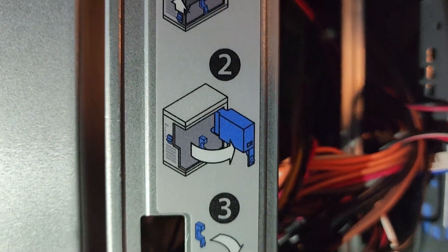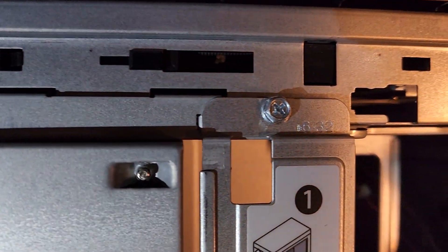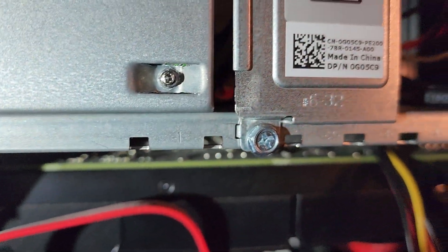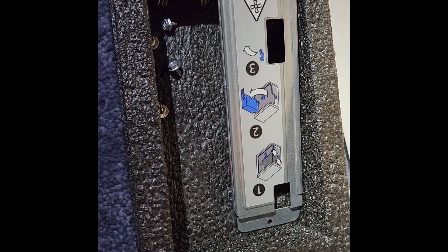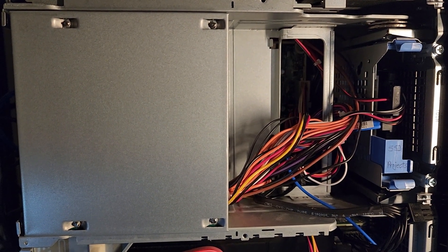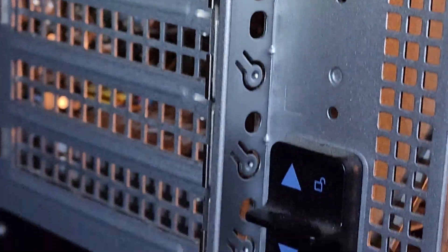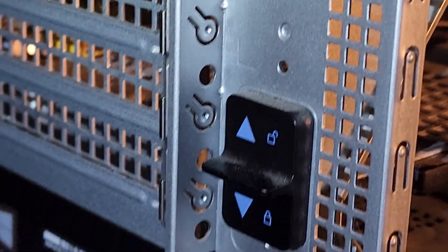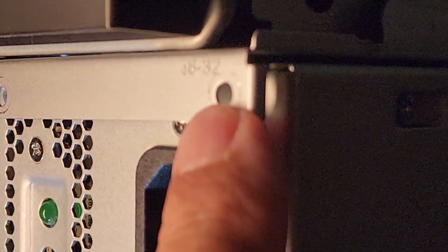Side panel's off. Now look at this little bar right here — it has two little screws, so I'm going to take those off and remove that. I have a new power supply. When I bought this XPS 8930 from Dell it was a special edition, touted as super high speed and super powerful, so I had them upgrade the graphics card to the Nvidia GeForce GTX 1080. But then I looked it up after having problems — the GTX 1080 has a minimum power supply requirement of 500 watts. What does Dell include? 460 watts.